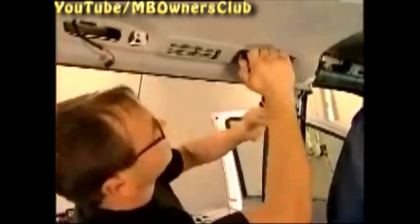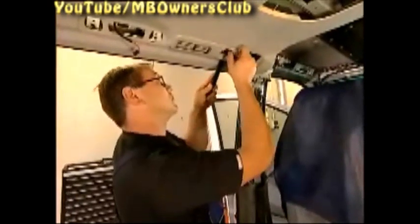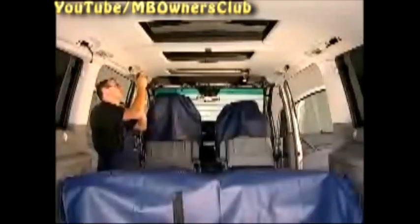Afterwards, unscrew both baggage net fixtures. Otherwise, you won't be able to remove the 4 rear vents. With a long wedge, loosen the air vent, push forward and remove. The air vents on both sides are next to the hold handles we've already removed.